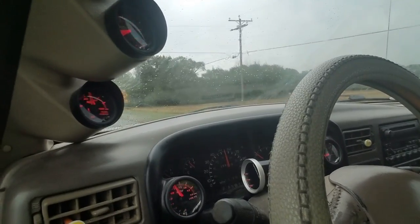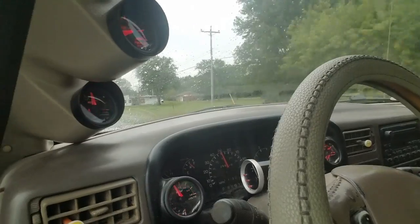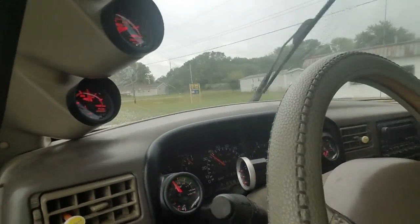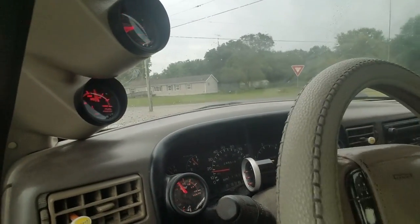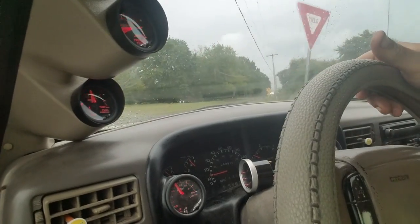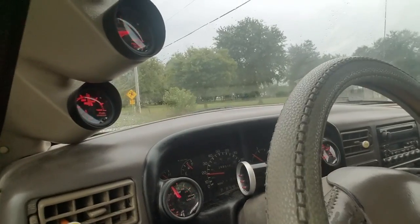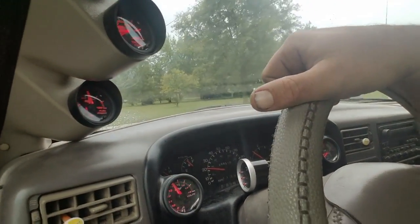With pushing it, I was roughly up to about 1,200 EGTs. I just don't want to go past that — anything higher than 1,200 and I'm going to get a little leery of what can happen. I know I got an overboost code. For some reason I have the sensor in there that's supposed to correct that, but for some reason it doesn't.